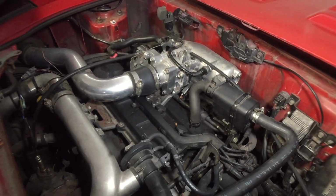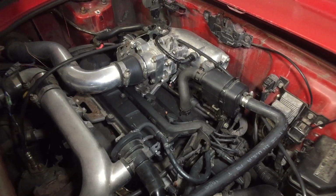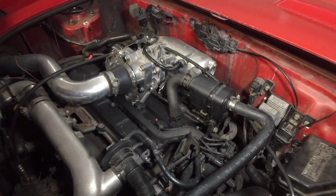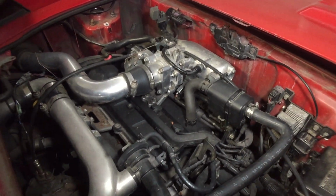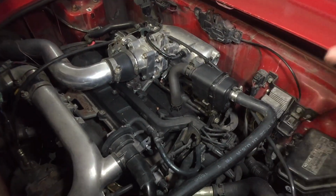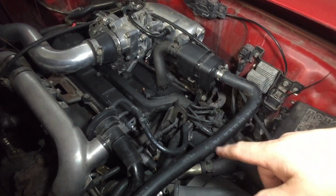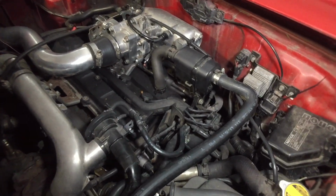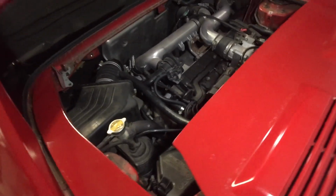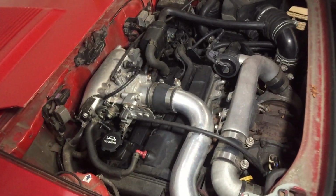So I'm going to be taking the fuel injectors out, and I'm going to be sending those out to get cleaned and flow matched and all that. So that's the reason the car will be sitting here for about a week or two, not running, because I don't know how long that's going to take. In the meantime, while stuff is removed here, I'll go through everything. Vacuum lines. I got new plugs, new plug wires for Gen 3 as well. I'm going to check for any vacuum leaks and just see if I can find anything else. I mean, it's starting to get kind of annoying, but I got to get this done. Got to get this thing running so I can keep on moving.